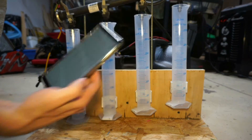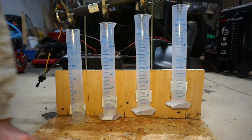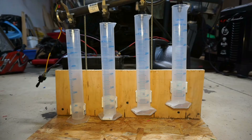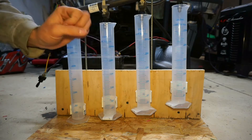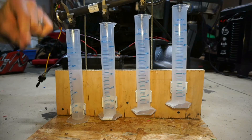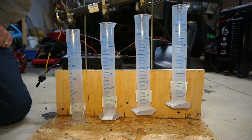I'm probably going to set a timer — take a phone or something like that and set a timer for 10 or 20 seconds. Run the pump, make sure the test is consistent. I'll run them for 20 seconds and mark the injector so I know what number they are and what volume they ended up at at the end of the interval. Just so I know they're consistent and match. I'll take the ones that match the closest and use those for the truck.